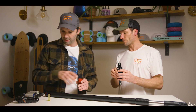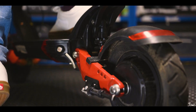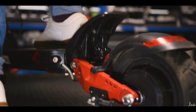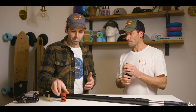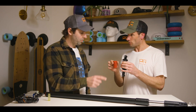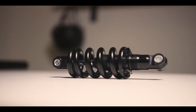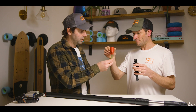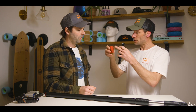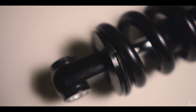So again when riding it's going to bounce you — if you go over a two-inch bump you're probably going to go two inches high. The Zero range are known for quite advanced suspension in the market, but is there much difference between the basic coil-over and a hydraulic version? The difference is this has its own supporting mechanism — the shock body — whereas the bare coil just has a bolt through the center to hold it in place. So there is a bit more advancement in this, but you still can't control it like you could with a hydraulic shock where everything is controlled by the shock absorber.